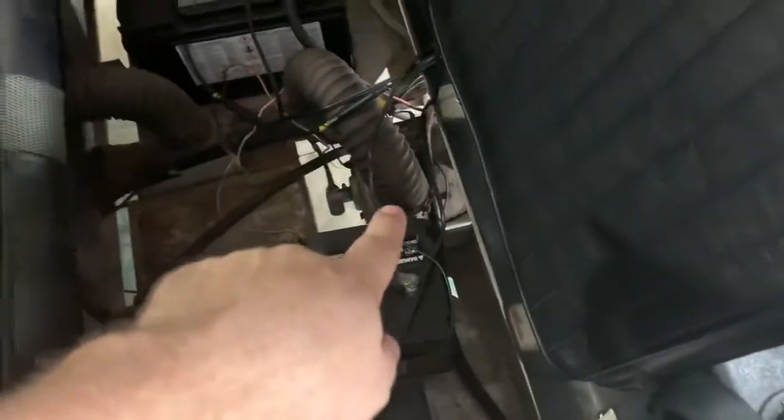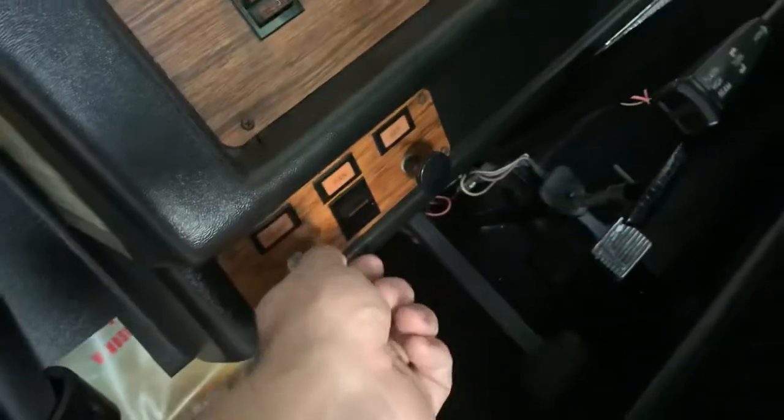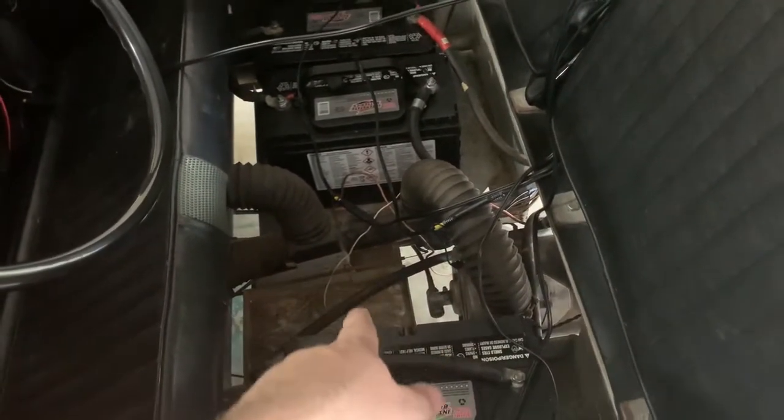Let me show you what I'm actually replacing with the old motor. Here are all the batteries — you can see there's more room over here than over there, so I'll have more room to put more stuff in. You can see this vent coming out — that's the force cooling, but it's also my heater and defroster. Back in '76 they didn't have 12-volt accessories that could do that, so they relied on the heat of the motor. These are all manual — there are flaps in that tube that control whether you're in defrost or heat mode.